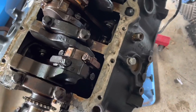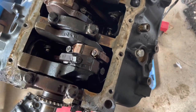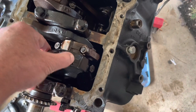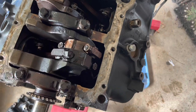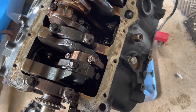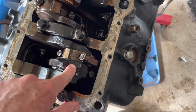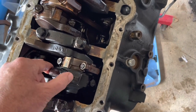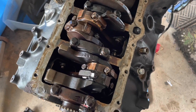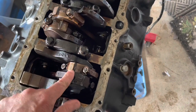This is what they classically call rod knock. When you have an engine with a rod like this, as the piston rides up and down it creates a knocking sound - a rapid knock knock knock. This is not that far gone, probably not as bad a rod knock as normal, but it's a sign the engine is about to go. If you've watched my videos, this is typically caused by low octane gas. Running high RPM starts detonation, which creates severe downward forces - almost a hammering effect - and these rod bearings get hammered looser and looser. This is ultimately caused by using basic 87 octane gas. Remember, Mercury requires at least 89 octane.